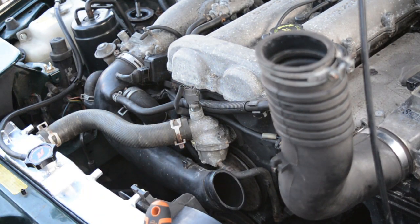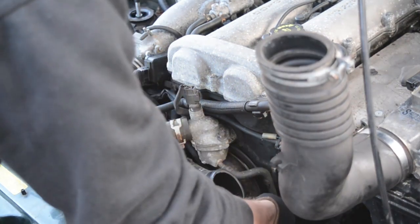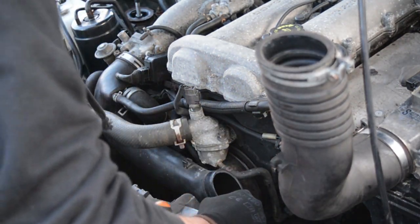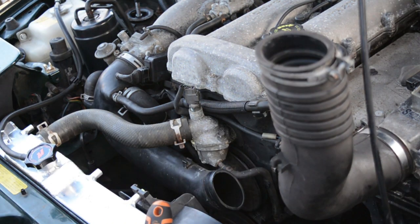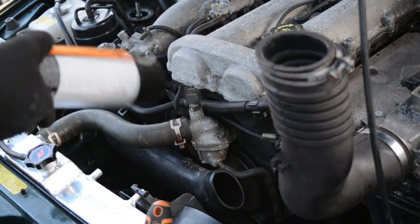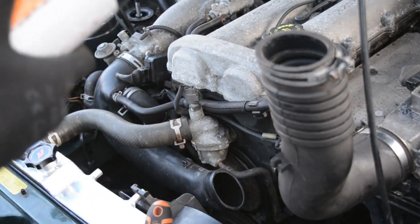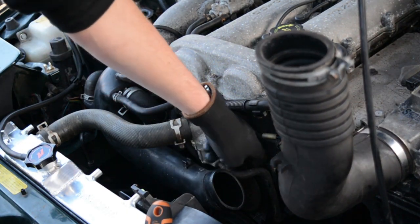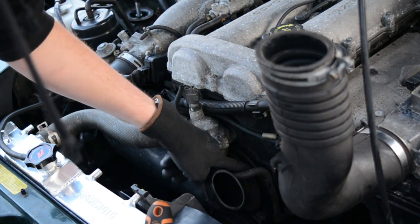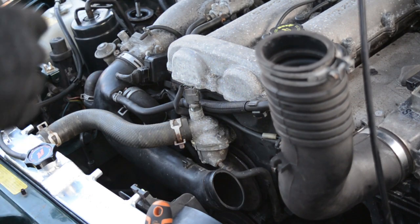There you go — as you can see that's the old belt out. I only took off one section of the induction piping just so I could get my hand in there a little better. It's spinning perfectly fine, nice and free, and the alternator pulley is also spinning nicely. So I'm going to grab some brake cleaner and get it around all of the rims of the pulleys, which will help get off any residue from the old belt. Often old rubber gets jammed up in there — you can't really see it, but it causes squealing or slipping. Cleaning them off does help.